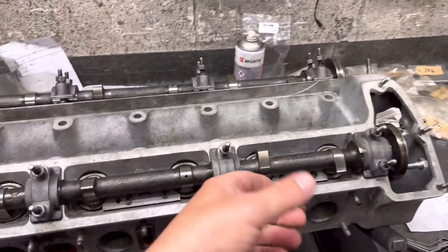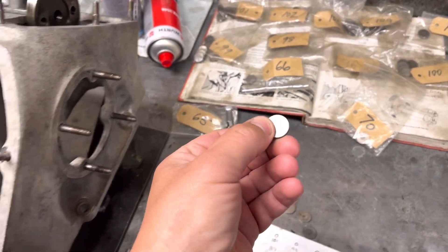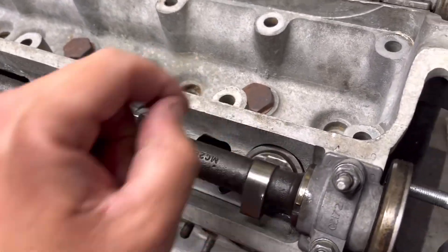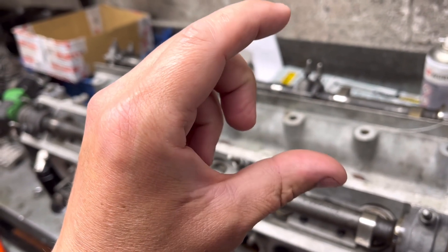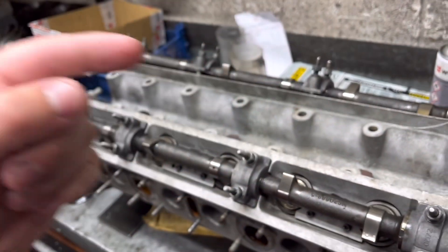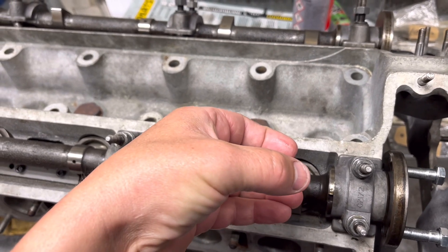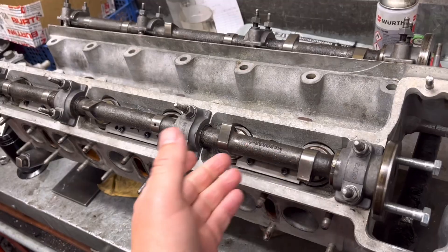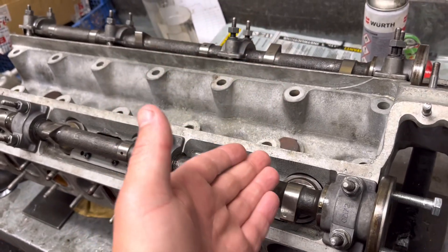On this particular head you've got a bucket and underneath you've got a shim — that's a common type of setup. You've got various different setups. You've got a hydraulic lifter — this is not in these cylinder heads but generally — which is a bucket that sort of looks like that, except underneath it has either got a single or a double spring-loaded one-way valve in it. With a hole in the side, you have an oil feed going through the head, and the oil feed goes into the bucket and fills up the chamber. Because of the one-way valve it takes up the clearance — self-adjusting if you like.